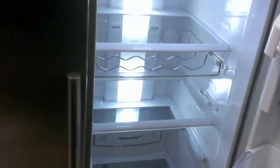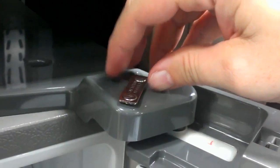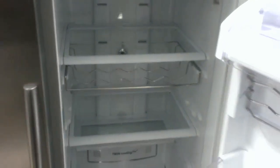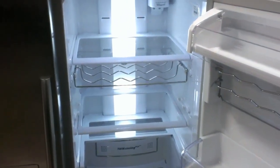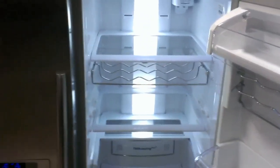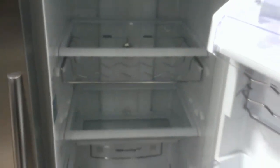It's just a magnet. You're going to place the magnet on top of the hinge plate here. When I put the magnet on top of the hinge plate, the lights went off. If I remove the magnet, the lights will come back on. So if you want to put your Samsung refrigerator in Sabbath mode, all it requires is a magnet to the hinge plate right here in the corner. That is how you shut off the lights for Sabbath mode.